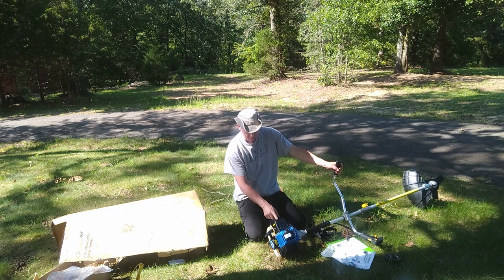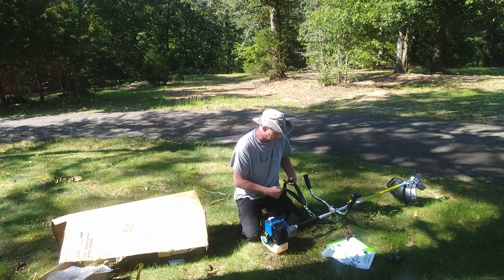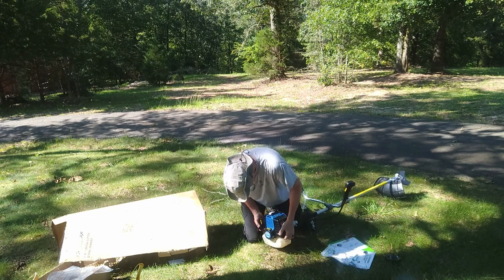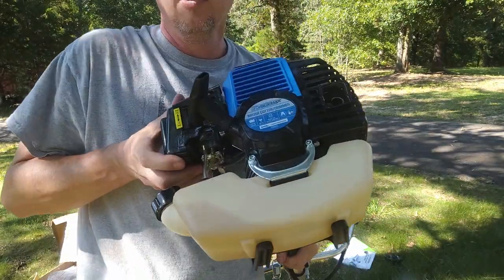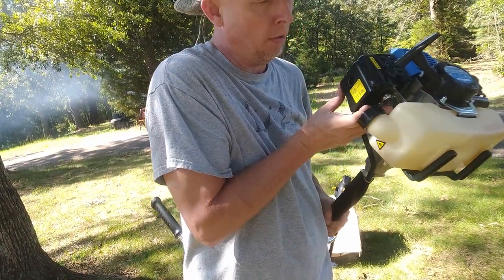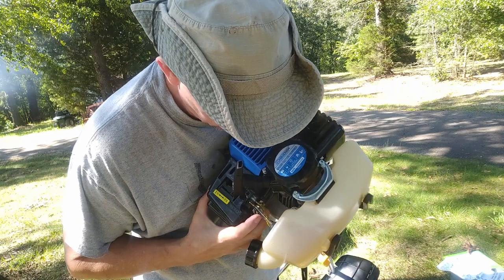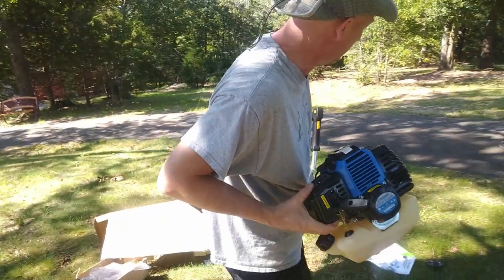So it says it has 113 decibel. So you definitely want to use ear protection when you're running it. And anyway, so let's get this puppy primed, see where the primer is. Oh, there's a primer bulb. Right here underneath, if you can see it. Alright, thing wanted to rotate and follow me. So it's right here from the gas cap inside, there's a primer bulb right there. See the gas going into the carburetor tube. So now I got the bulb. Bulb's full. I give it one extra squish.